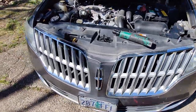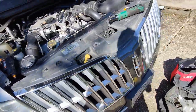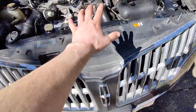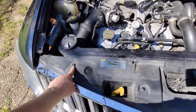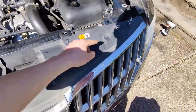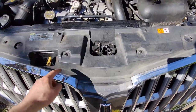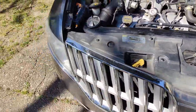So taking the bumper off so I can replace the ballast on this headlight on the passenger side — it seems pretty easy. The bumper comes off as all one piece, all of this and the bottom. You've got a 10-millimeter bolt up here, same as here, and then these are just screws — these four. Mine's actually stripped on this one but this one was okay.